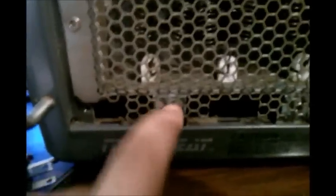I have removed the top cover — it had these little star-headed screws on it, so I got my star bit out and took those out. Now you see inside here is all of the wiring, which we don't really want to mess with. But here is the main heater unit and it's got these screws — these hold both the grate and the heater unit in. There are two at the bottom that are just in the heater unit itself. And then mounted on the back of this is the fan unit. So I am going to take that out now.